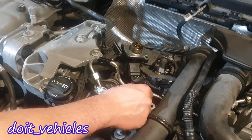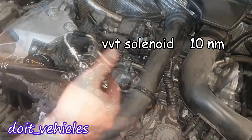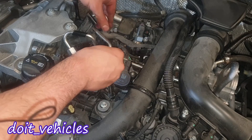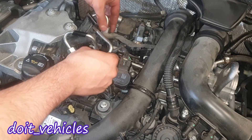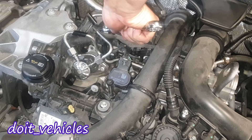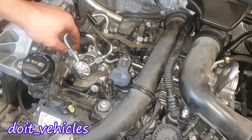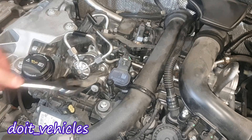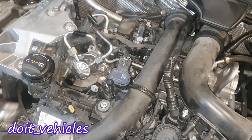Just hold back these bolts — for these you need 10 Nm. Now just place this line on and tighten these nuts by hand. Make sure you tighten them equally and do not apply too much force — just remember the same force you applied when you removed them, which is going to be around 15 Nm.